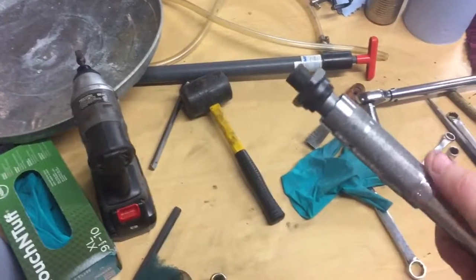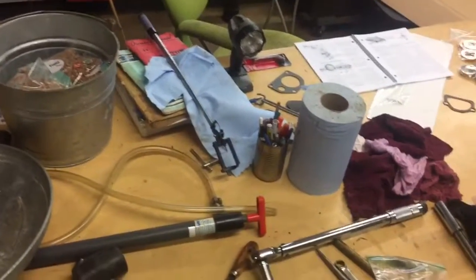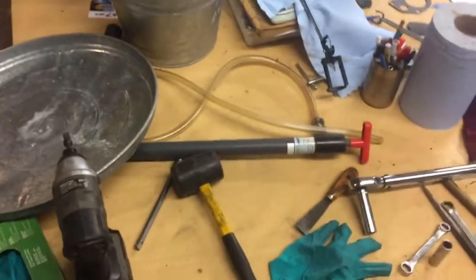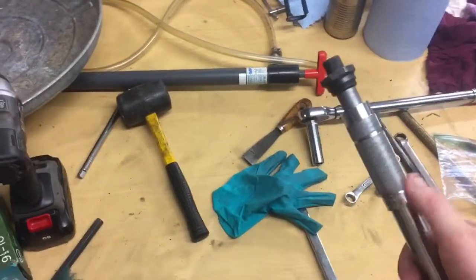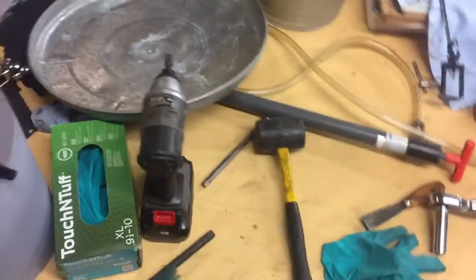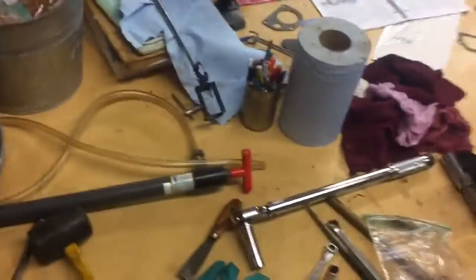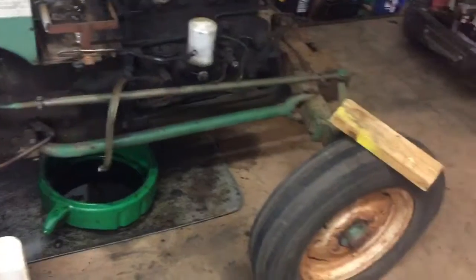We're going to jack them up to 112, which is the spec, according to a service manual I ordered from eBay. And I was just adjusting it up, and it just went snap and came apart. And I said, well, even if I managed to get it back together, I wouldn't trust it. So I went to Advance and bought one that was twice as expensive, still cheap. So I got the head bolts torqued down.